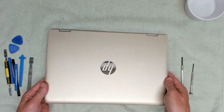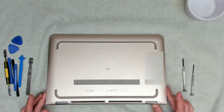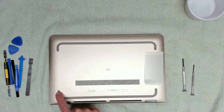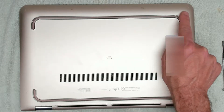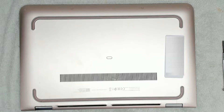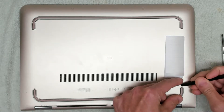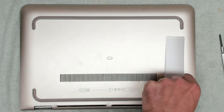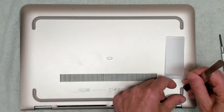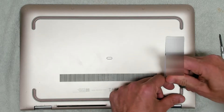The first thing we're going to do is flip the device over. You'll notice that there are no exposed screws at the moment. The screws are under the back rubber foot, under the front rubber blocks, and then one in the center. The first thing we need to do is remove those, and we want to get under one of the corners on the rubber foot at the back. It can be quite tricky to get into depending on how old or how long it's been stuck down.